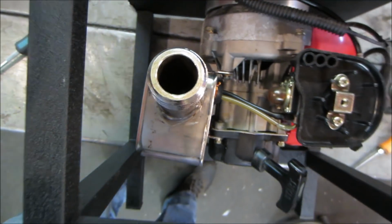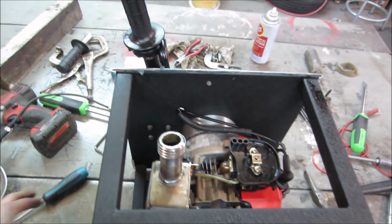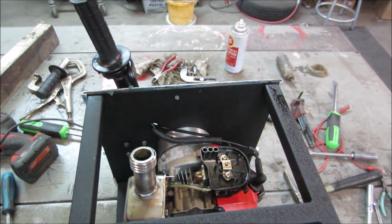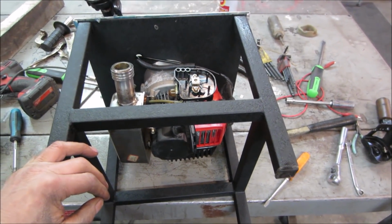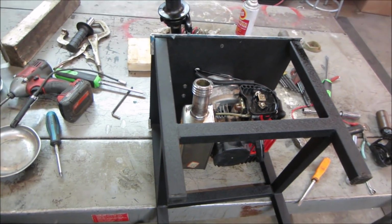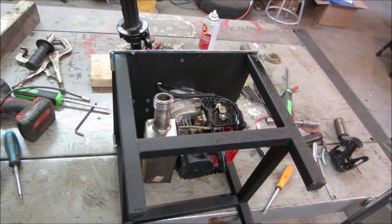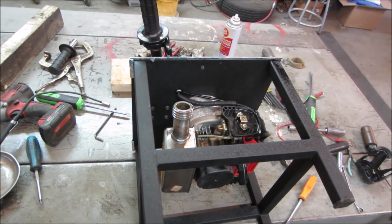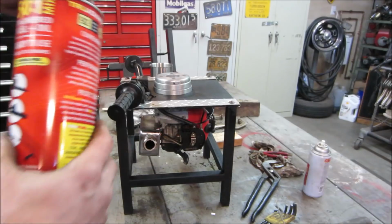That's a little bit of oil I put in there just to keep the tank from flash rusting after I rinsed it out with the water. So the coating, the tanks, you know, you do like a motorcycle gas tank and you put the coating stuff in afterwards, I'm kind of having second thoughts on that. I think sometimes it does more damage than good. I think I may just try leaving the tanks raw and keeping fuel in them, see how they hold up compared to the other stuff, because I've had some problems where it's lifted and just made a mess of the tank, and once it's in there it's kind of screwed. So we'll see how that works out for us.